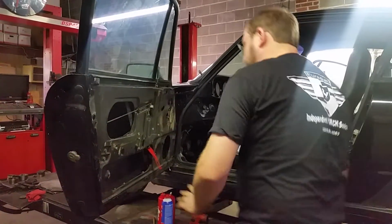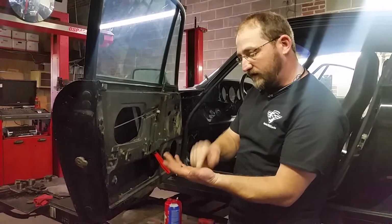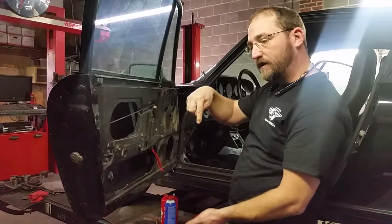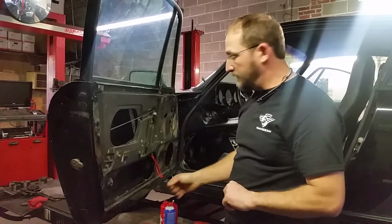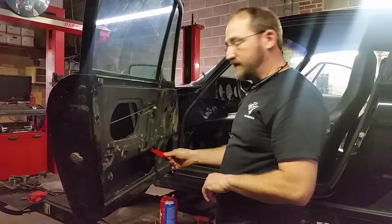So now that you've installed your jack nuts, you've also gone ahead and installed our handle. There's a little plastic clip that you pop out and you put this bolt. Make sure the bolt goes down and the nut comes up from the bottom, otherwise the linkage will get caught up. You want this handle to go back just a tad, about like that, okay?